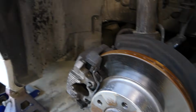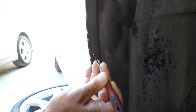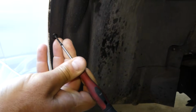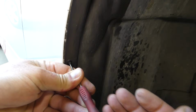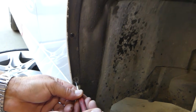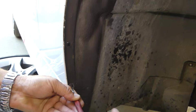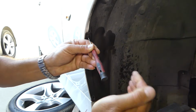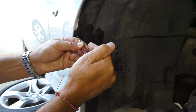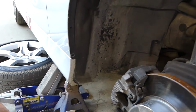You can see the wheel is removed already. Now we need a small screwdriver so we can push those clips in. The middle part will go in, so later we will have to hunt for that thing. You can see this one fell out, one on the bottom, and one on top. So you have three clips where the middle piece needs to be pushed in until it comes loose. Sometimes you won't be able to find them, so we'll include the clips that we purchased in the description of the video, so please check them out.